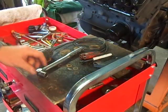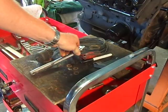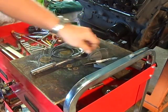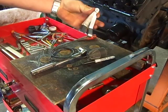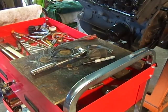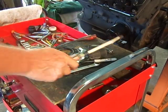Let's get started. Here are the tools you're going to need: a breaker bar with a half-inch or 7/16 socket — adjusters are different on different engines — a remote starter, and a set of feeler gauges. You can use go/no-go or just flat ones. If you have the earlier style rockers with a lock nut on them, you need a 5/8 box-end wrench and a flat screwdriver.